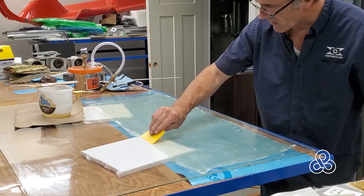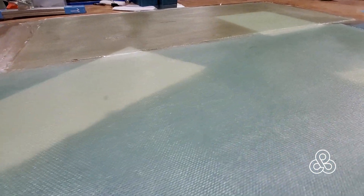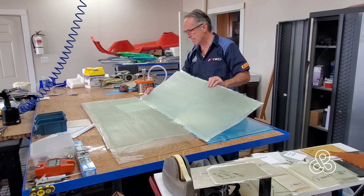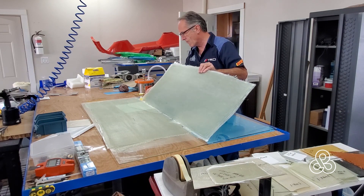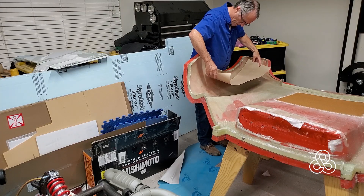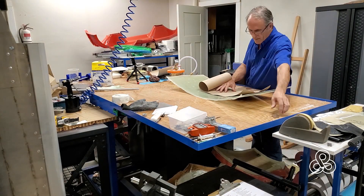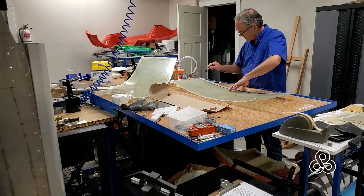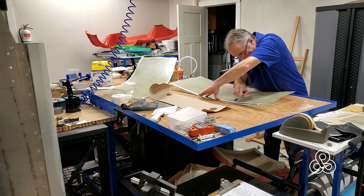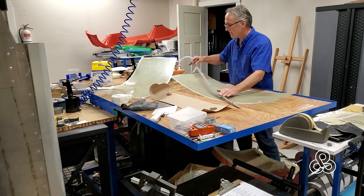You're going to build a couple of these flat panels, one for each side. Here they are finished. Since I did this on glass they release nice and easily. I'll pop those panels off and then go back to the clamshell to take a pattern, because there's a little bit of a curve underneath that wheel well that we want to butt these panels up against. I'm going to cut them to the same size to keep them symmetrical, then take my pattern and cut that slight arch onto one side.